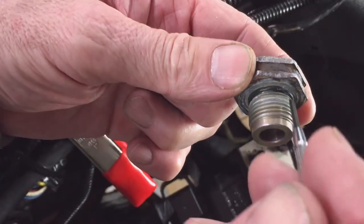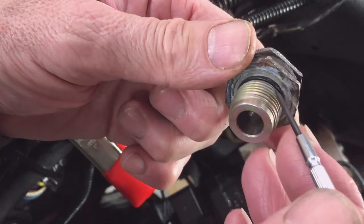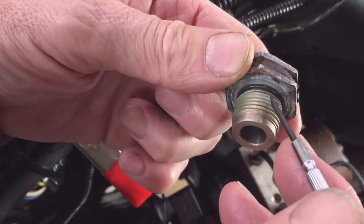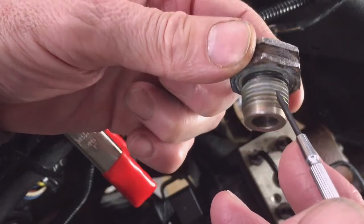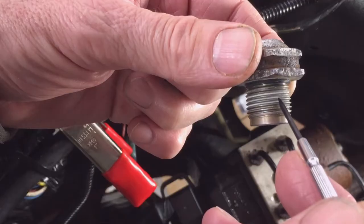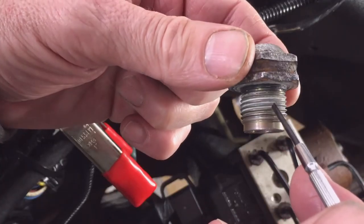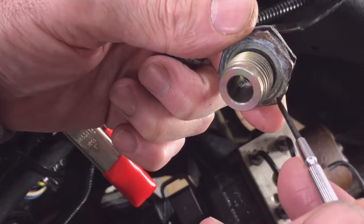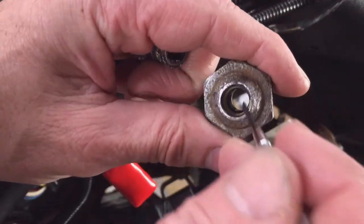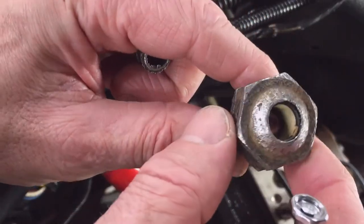It's hard to see, but you can see the O-ring on the outside is almost non-existent, or doesn't look like it's going to provide a lot of sealing. So expecting the threads to seal, so it has some thread sealer or something on it here, and that didn't clean off from the solvent. So a little bit of sealer here and here, hopefully that'll seal. And then if the O-ring inside doesn't seal, I'll have to replace it.